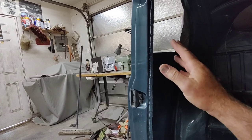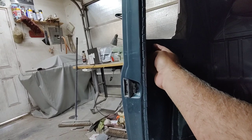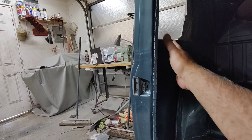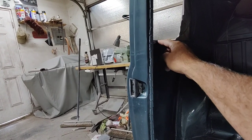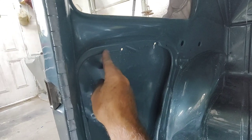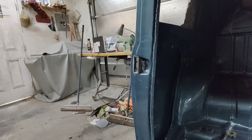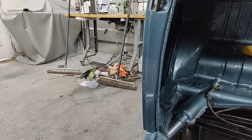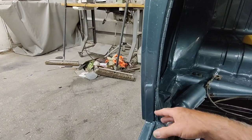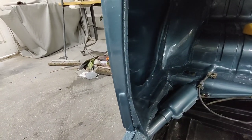And don't put glue anywhere other than the very edges, here and here. No glue in the middle. If there's glue in the middle, it'll look all raggedy. So you want to stretch it over that area. So it's going to be glue here, glue down here, and where the door panel is. You can see there, I would have glue down here and glue up there, none in the middle. So that's all the key things to know when you're putting it in. If you put glue all over the place, it's going to just look all raggedy and gross, so pull it tight over the areas.